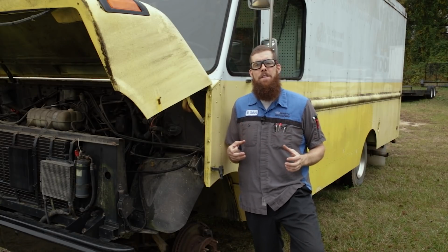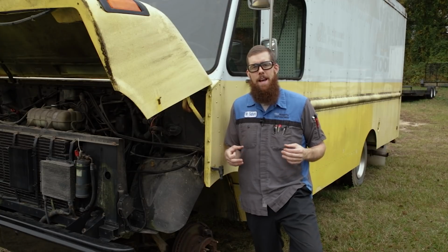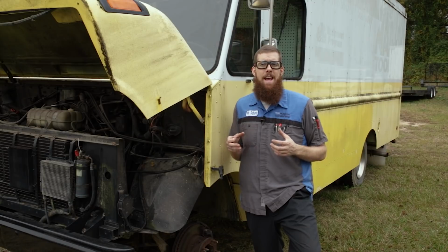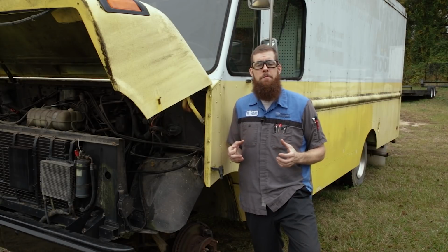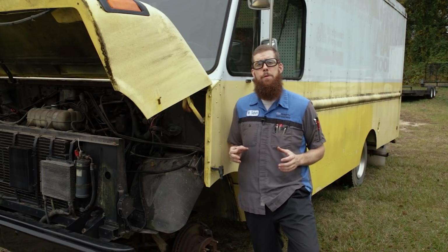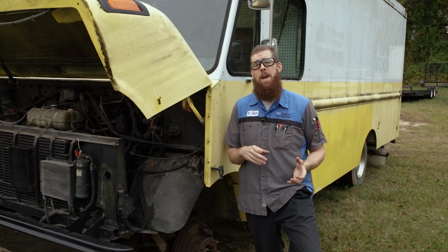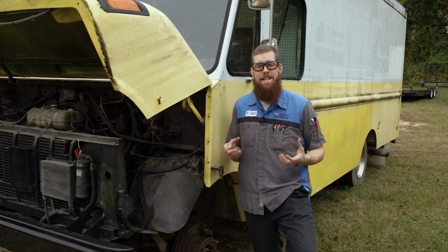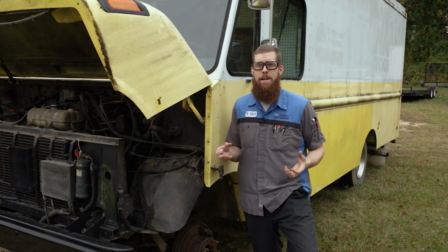So at the end of that video, it was getting dark on me. I was hastily trying to get everything wrapped up. I went to bleed the brakes and had an issue. I should have known something was up because when I took the brake line loose from the caliper, when I put the new caliper on, I didn't get a lot of brake fluid out. It should have poured out on me as I was switching the line over, but it barely dripped a drop.